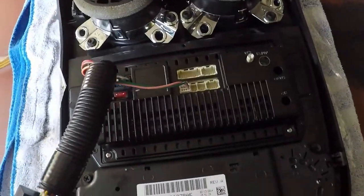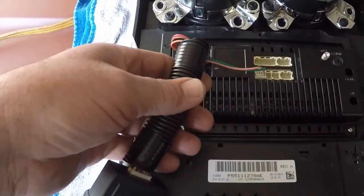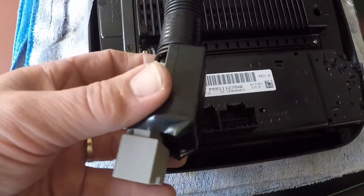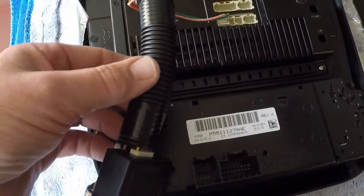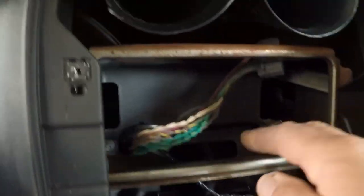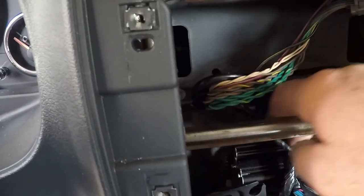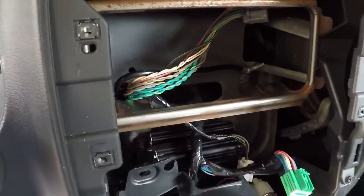The stereo fit and tested. I taped the wire pack together. This black module was flopping around so I taped it up. I put a little chafe loom on this wire because where it sits in the car — where the radio used to sit in this hole — that wire is just gonna rest on a piece of metal. The loom will keep it from getting chafed on that edge.